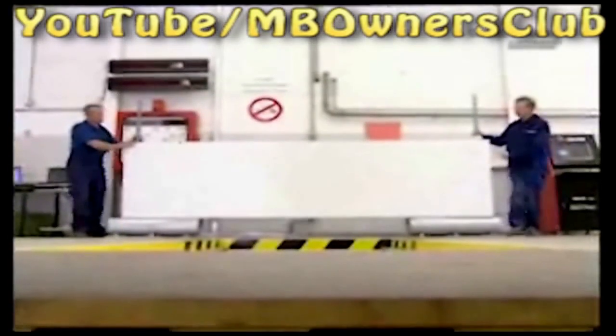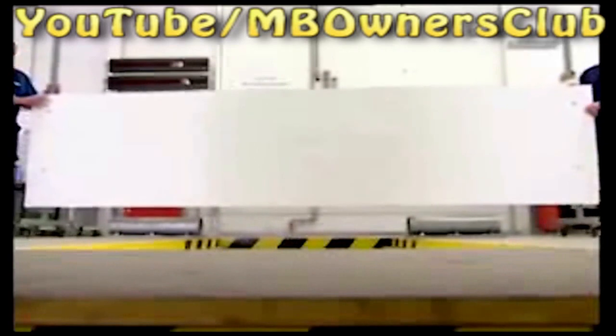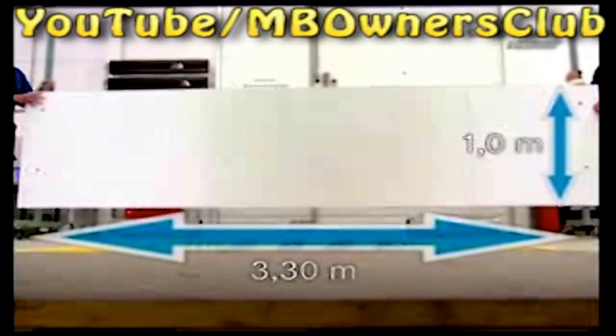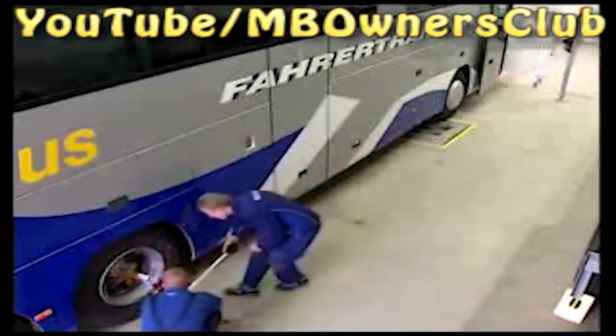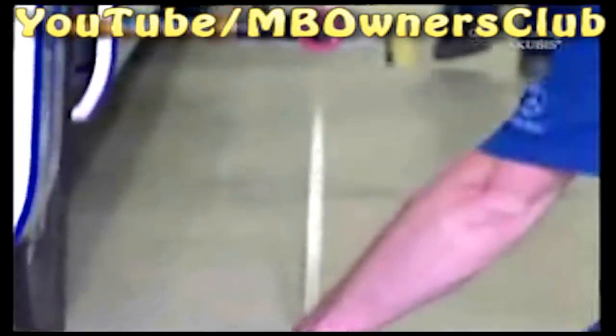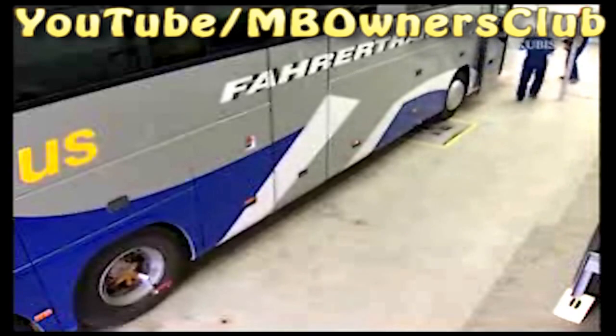Get the adjustment board with a colleague. The board is plastic coated with a size of at least 3 meters 30 wide and 1 meter high. Move the board as close as possible to the adjustment device. Then get a tape measure at least 25 meters long. Together with a colleague, measure the correct distance from the center of the drive axle to the front panel. Make a note of this value. Do the same on the other side. Make sure that the board is aligned parallel to the drive axle.